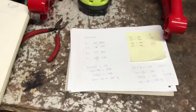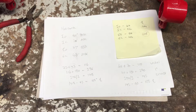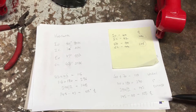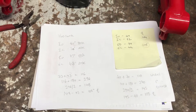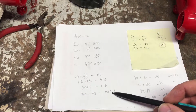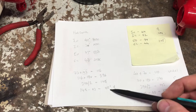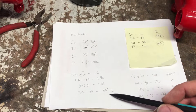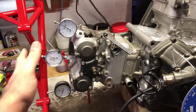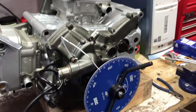Today was about checking timing and we can see on the horizontal that we have got a retarded intake, which is okay for top end power, but I want to improve the mid-range so I really want to advance that. And we've got a pretty much bang-on exhaust cam center line, but really you want to retard that by about two degrees.